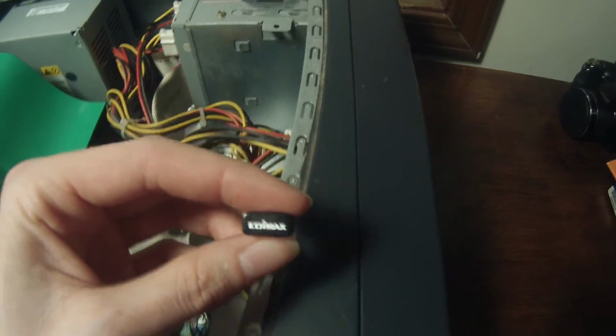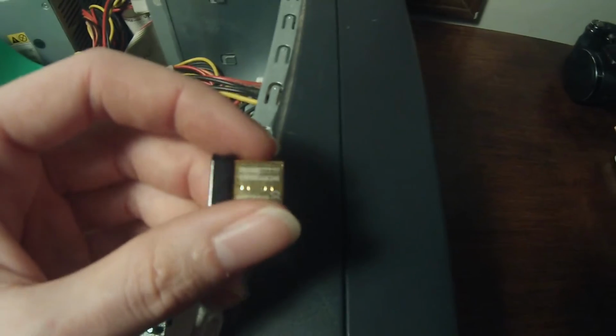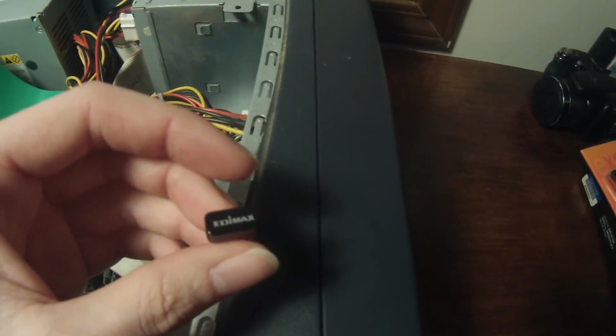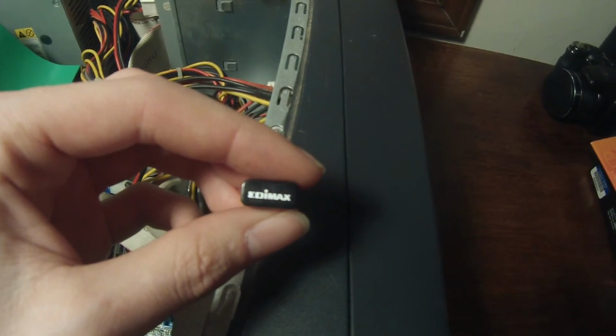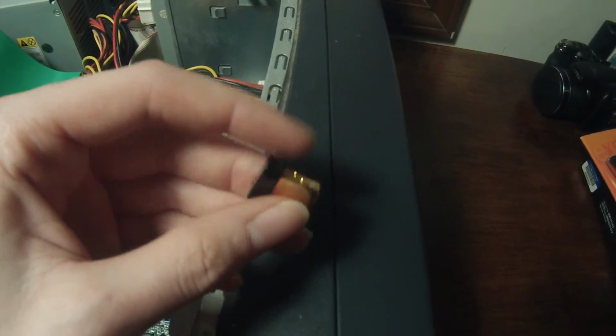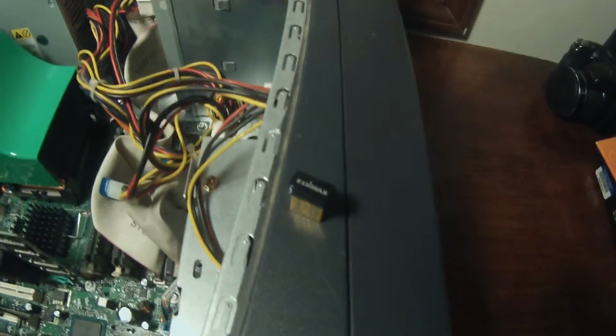And it's something really nice to have in my toolkit, because whenever I run into a computer that I'm installing Windows on and it doesn't have network drivers, I can pop this in, and I have the drivers handy on a flash drive, so I can install them and then let Windows Update install the drivers for that machine without having to hunt down the proper drivers for that machine's network adapter. So pretty handy little thing.